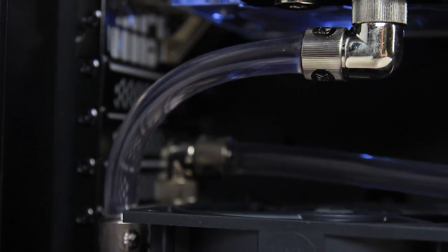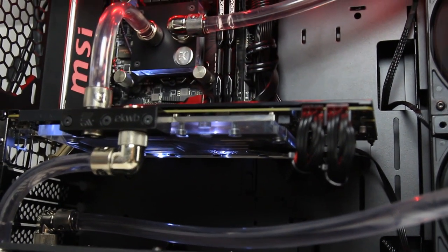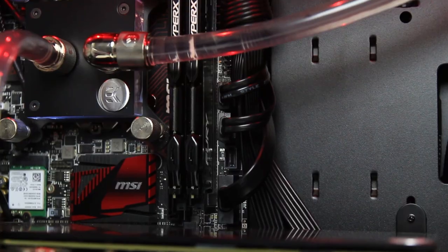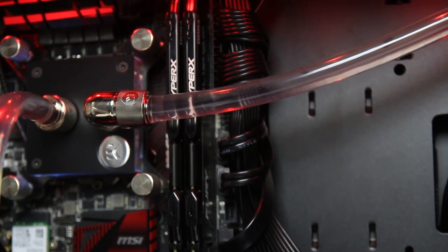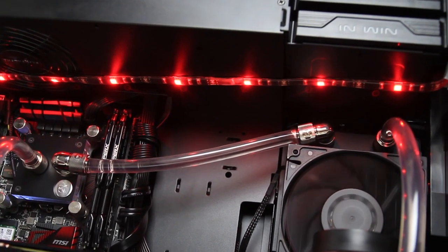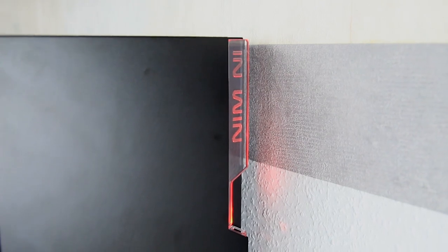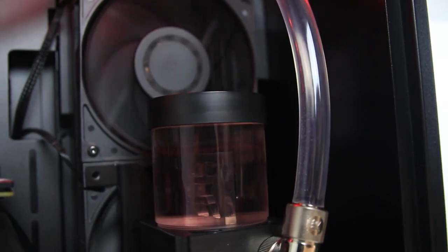Building the PC and the water cooling loop was easy, cable management too. But keep in mind that from my point of view, there is not enough clearance to install a 360 rad on the bottom and a 240 on the side, with fans attached. I have slim rads by EK water blocks and this combo won't fit.